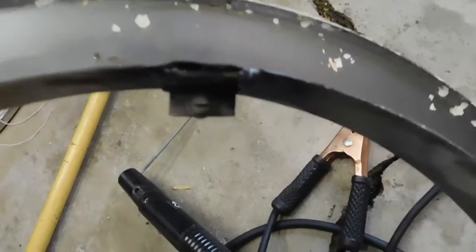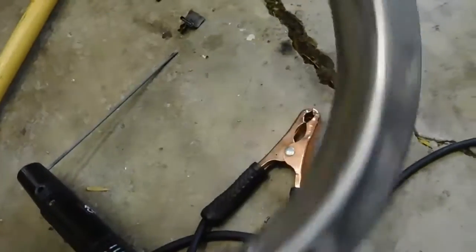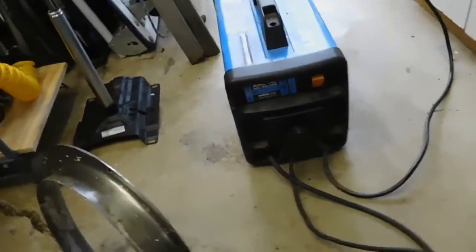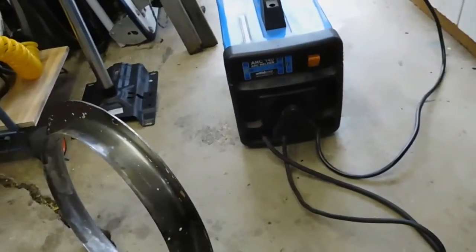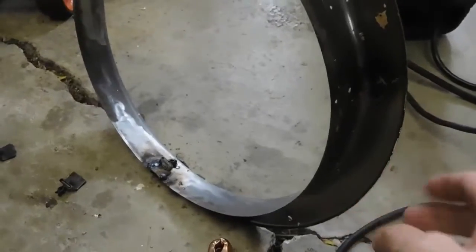I was working out different ways to put them on — I was thinking of actually bolting them back on, but that'd be way too hard and the bolt heads would stick out too far, so I've decided to weld them. It's the easiest way and that way they'll hold nice and secure. The good old arc welder does the job fine. I've had this thing for a while — got it for Christmas actually. I had issues with the rods always sticking, and basically I just wasn't turning it up enough. I've got it at about 115 amps, and for sheet metal and thin metal like this you do need to turn it up a bit and use a thinner rod, but on thicker stuff it does just fine.